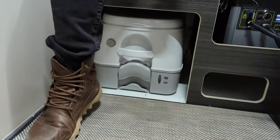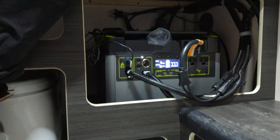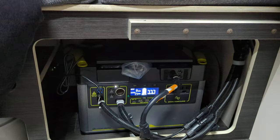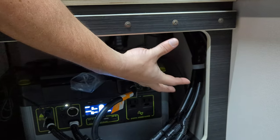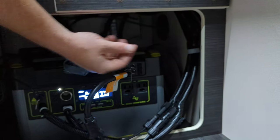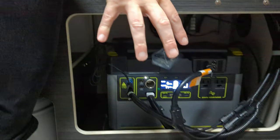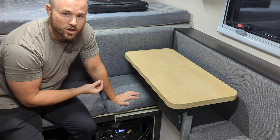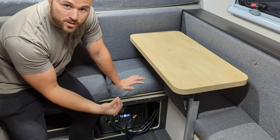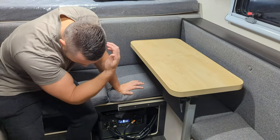There's a portable toilet option you can add from Scout or bring any toilet you prefer. Right here is the Goal Zero Yeti — one of three things that come standard on the Scout. It's the Goal Zero Yeti 1500x. All the plugs are labeled and all wires run to a fuse panel, nice and tidy. It now comes with an extra module so the Goal Zero knows to pick the higher power source automatically — if your truck is running it charges from the truck; if you have solar, it charges from solar.